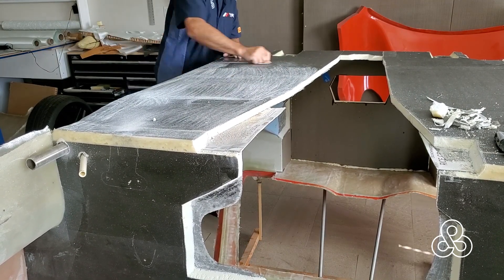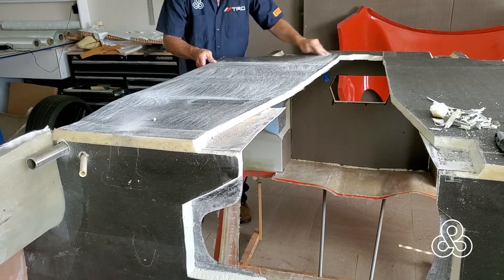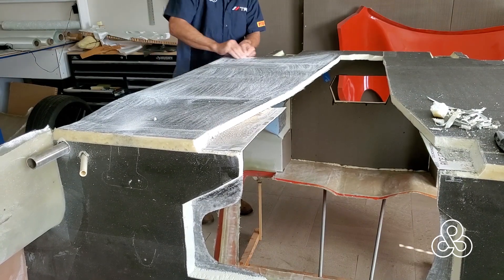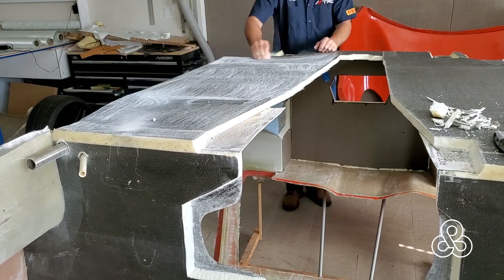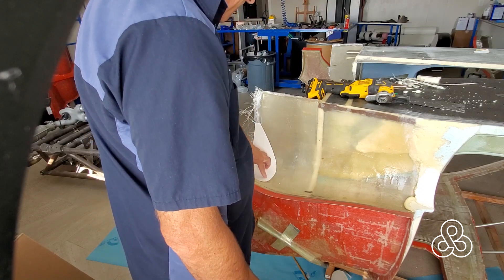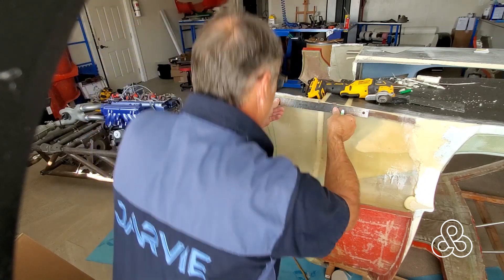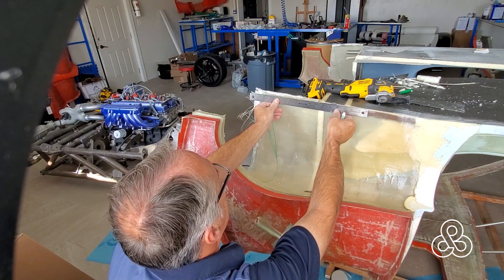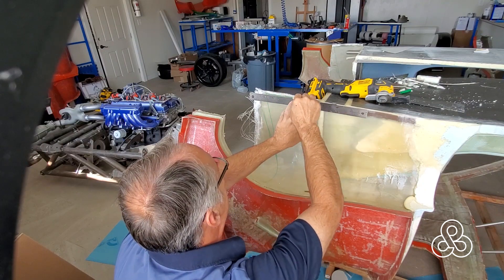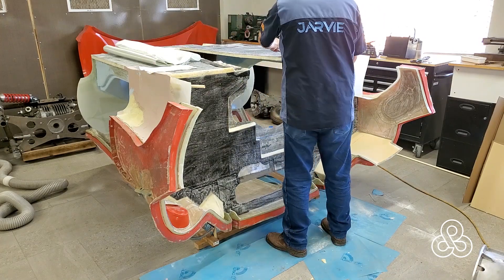While doing all this cleaning up and sanding, I decided to trim the little air ducts on the side of the car as well. So I created a little template, dropped that in there so I can match both sides. Once we're done it looks a little cleaner — because if you get those jagged fiberglass edges, the new laminations won't lay up tight against those pieces. So trim them up.